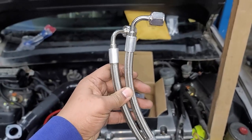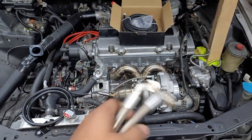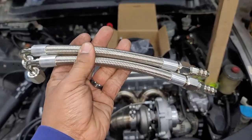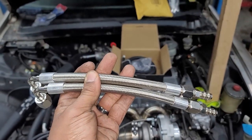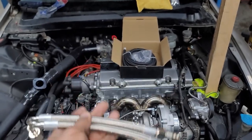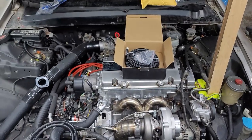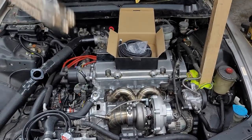This came in the water line kit: steel braided lines. I would assume that because of all the heat coming off the turbo and manifold you're going to want steel braided lines, at least to get some distance from the heat. Then from there they've got the barbed fittings on here which will fit the 6AN inline hose that will run throughout the rest of the car.